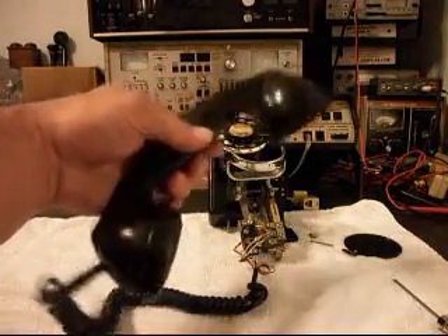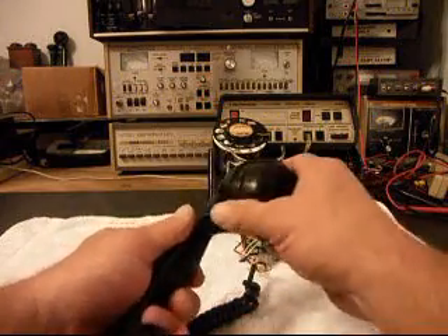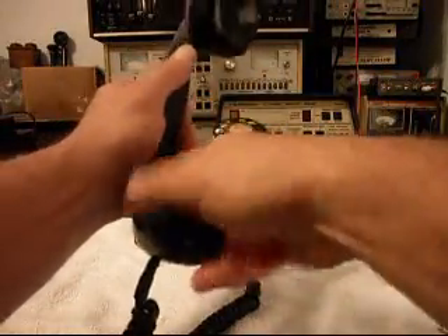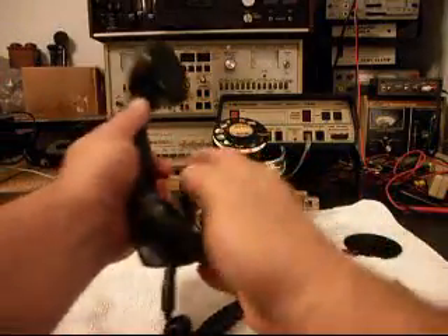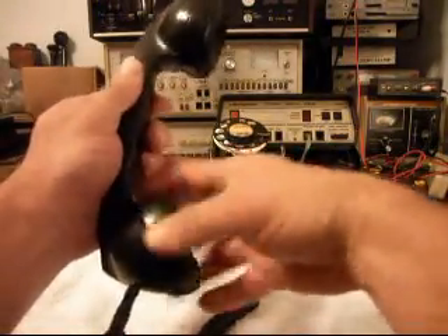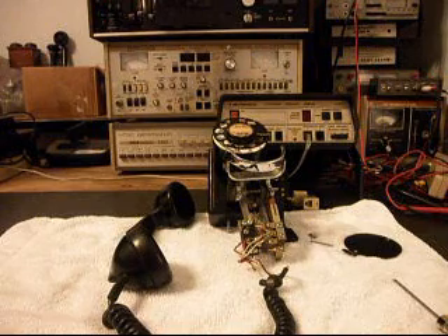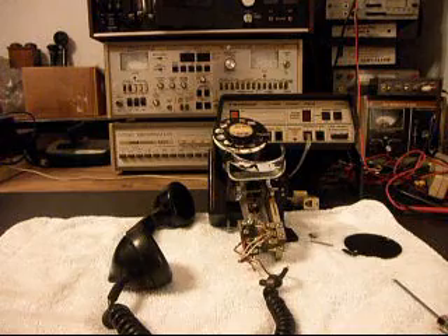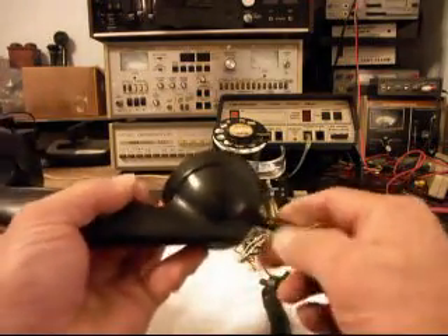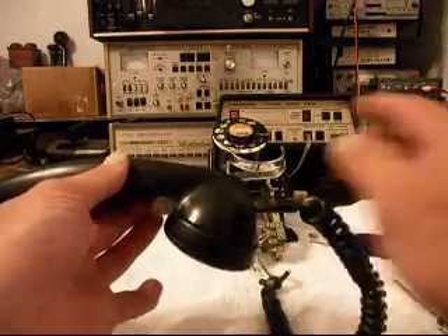Here's a look at the handset. We want to make sure that our receiver capsule's in it — I know he said he had dial tone, but I want to check that. We also want to clean those connections and give you a look at the transmitter. That is in the unit also. So we will go into that handset and clean those connections for the receiver and the transmitter. Even though that's not the problem with this unit, since it's in the shop we want to go through that and take care of that for him. We also want to take care of this handset cord — we want to make sure that doesn't come out in the future, as it looks like it's starting to come out.